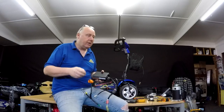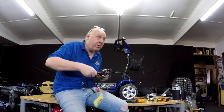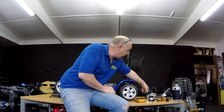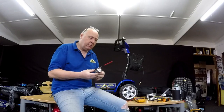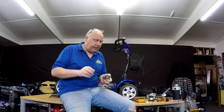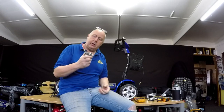There's a Shoprider one here — we can repair these at half the cost of a new one. So if you just send it to the head office we'll get that sorted, but always contact us before you send something, and always make sure you give your details. When I was away looking for control boxes, I did actually find another electric brake. This is exactly the same brake attached to this one — one that I've replaced in the past. What can happen with these? It's in manual at the moment, the disc is moving, but it's faulty and works on and off. Through time these get very weak. That's why we've always got them on the shelf — if you need a brake give us a shout. If it's not on our website, the link will be below; send us an email and pictures of your scooter and the brake.